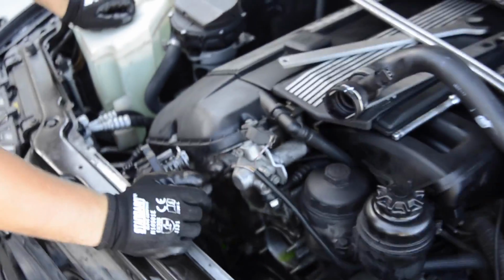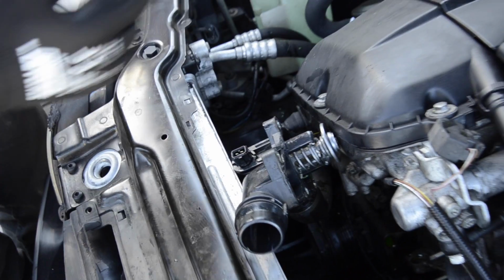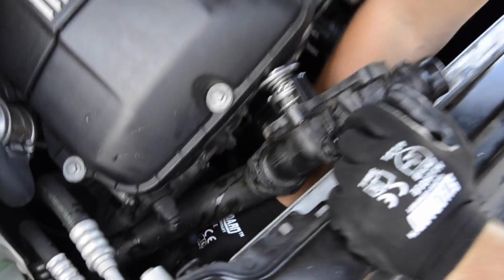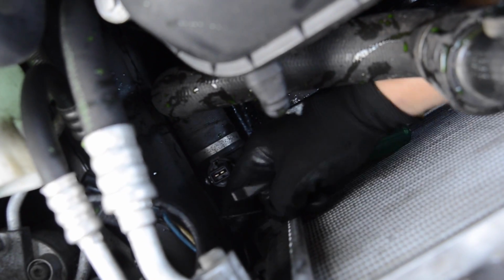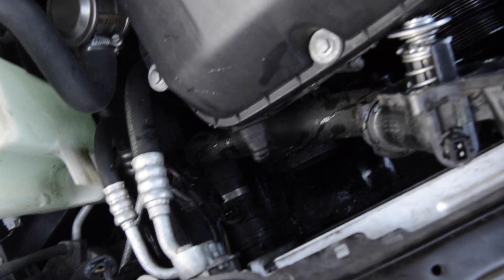So, as I said before, I'll try to lose a minimum of coolant, so I'll take one hose out and put another one straight back in. In order to do that, I'll need my screwdriver again. So okay, we're taking this thing right here and we'll take it all out. It's not necessary to do, but it's simpler to take the hose out because they usually get stuck, because of age, because of lack of lubrication or whatever. So you don't really need those parts because we'll replace the bolts and the hoses.